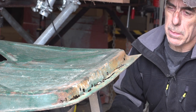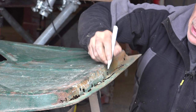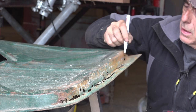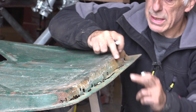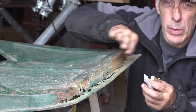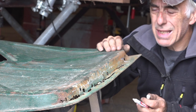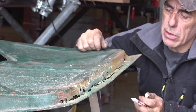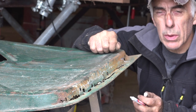The way we're going to fix this is by cutting this part off here. This piece over here is all right so I'll leave that as is. Then I'm going to try to bend this edge open a bit, make a panel that will go along here and slide underneath, then weld it in place. First I'm going to cut off the old metal so we have a better view of where we are.